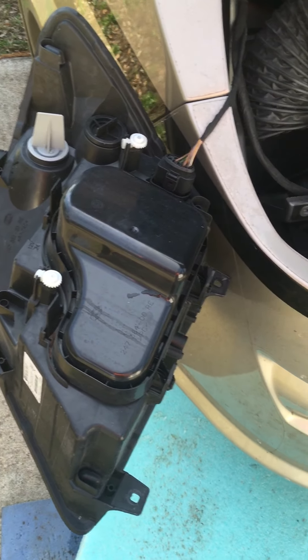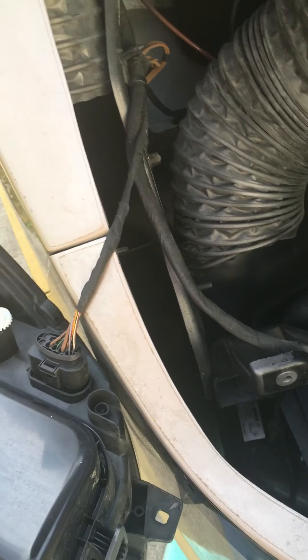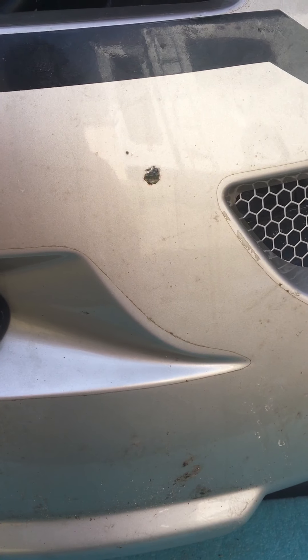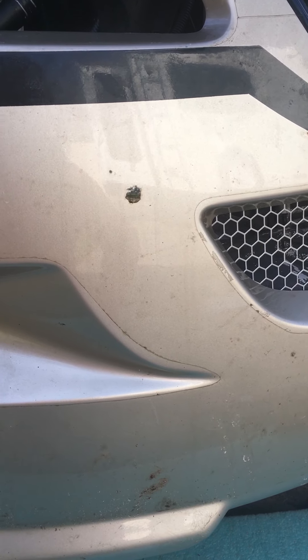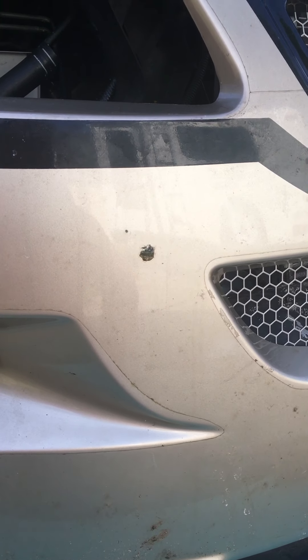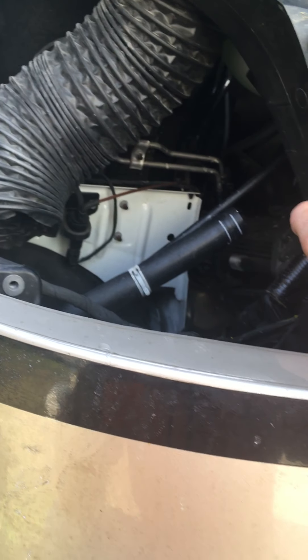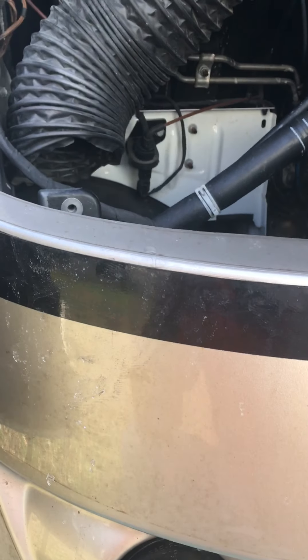If you have comments or questions let me know. You do not have to drop the bumper — this job, if you're inclined like I am, will take about two to three hours. When putting the bottom two headlight bolts back in, they're gonna want to fall off the T30 adapter because there's so little room. My trick is to use five-minute epoxy and literally epoxy the bolt to the T30 bit — as you screw it in it'll break off once it's seated. That's kind of a mechanic's trick. Thanks for watching.